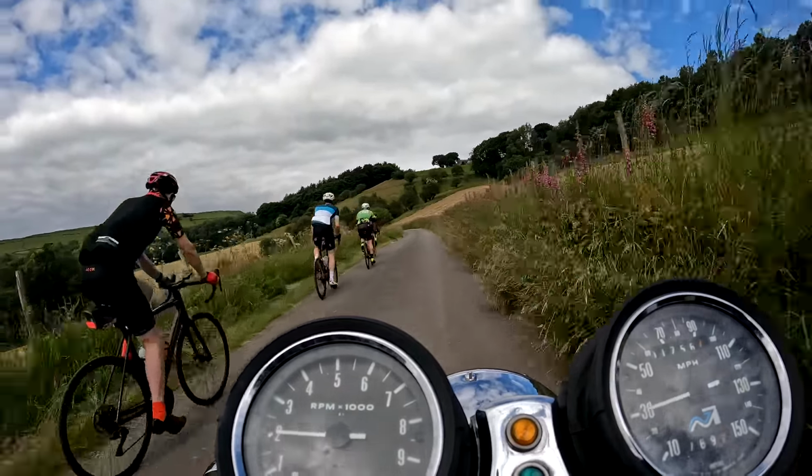I knew it was something like that. I thought it would probably be a bad earth on the ignition. There are so many bad earths that I know of in the past. That's the first thing to look for, a bad earth. But no, I checked everything, the earths were all okay. But we had power, things were turning over, the engine was turning over and so on. So it was something to do with the ignition, but it wasn't a bad earth.